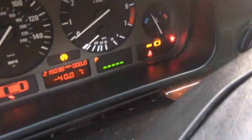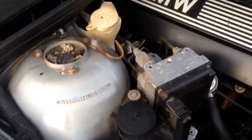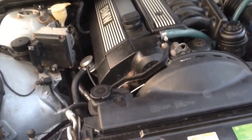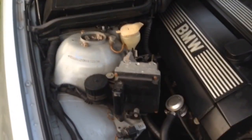Go back in and it should be reset — and it is, it's all back to green. That's your oil service light reset without a scanner. I had to look this up because I use a scanner so much I forgot how to do it manually. This works on the E36, E39, and I think even the E30 — anything that has the round port under the hood.